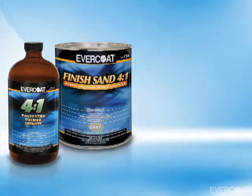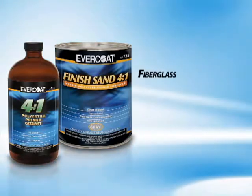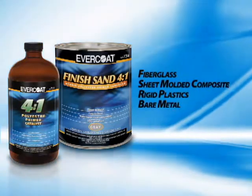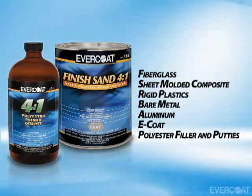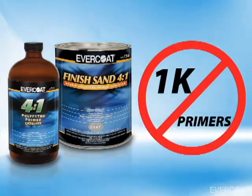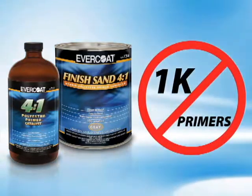Finish Sand 4:1 can be used on fiberglass, sheet-molded composite, rigid plastics, bare metal, aluminum, E-coat, and polyester filler and putties. Avoid using over single-component primers.